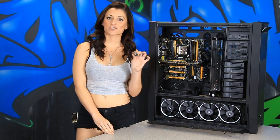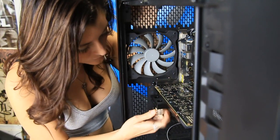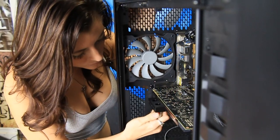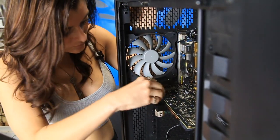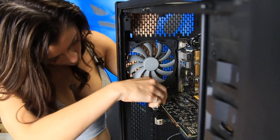Step six — now to apply the compression fittings to all the ports. You will notice that they come in two parts. We're going to separate them so that when we apply the tubing, we'll be ready to go. Depending on if you have any tight turns, you might want to think about getting some elbow fittings so that you don't bend your tubing too much and restrict water flow.